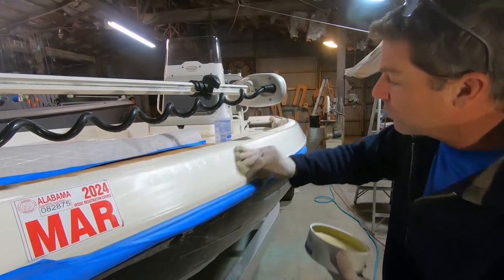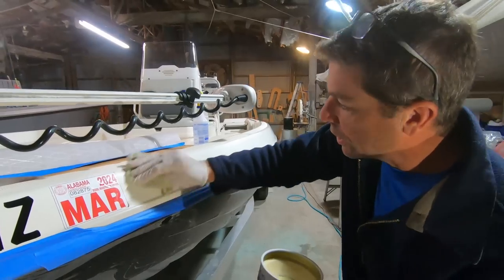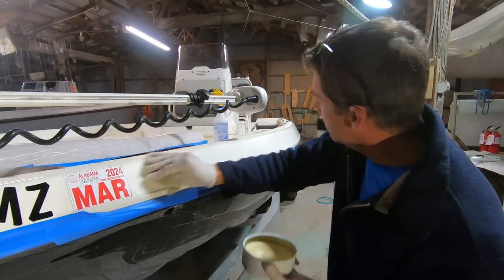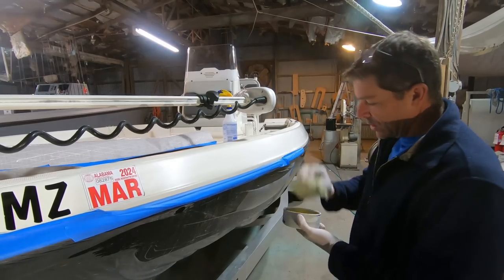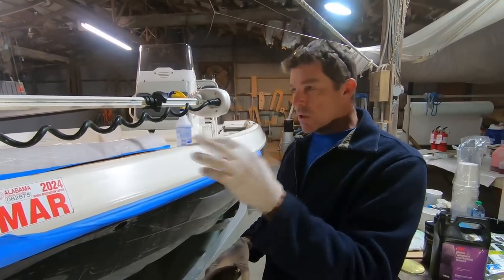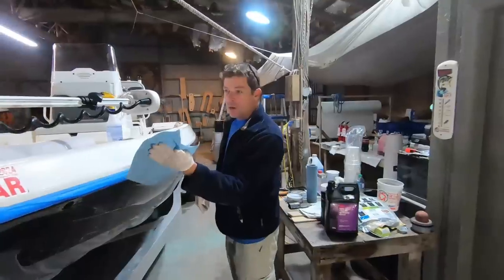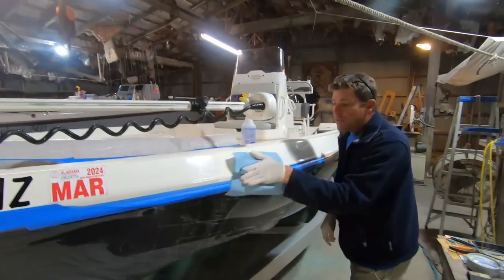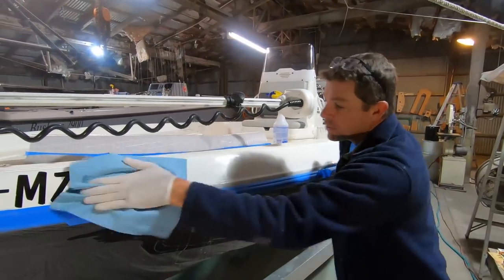You'll notice the theme here — we're going circular back and forth, really working that in. I want to be sure you get one really perfect coat of wax. We're going to give that a few minutes — generally wax is going to take about 10 minutes or so under most conditions. You want it to feel somewhat dry to the touch. Right now if you run your finger over that, you can feel it's smooth and moving around — give it long enough to tack off.